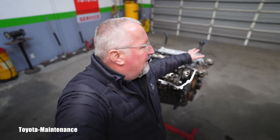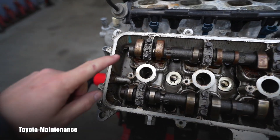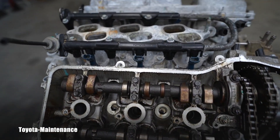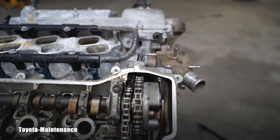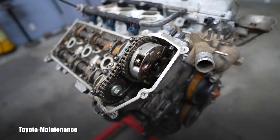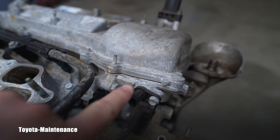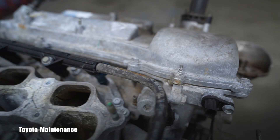We have no idea what's happening underneath the other side, which seems to be still factory closed. I will bet it was actually never resealed. This is what we saw on the passenger side — all that rust doesn't belong here. This engine was unfortunately exposed to the elements. It was from a 2008 Tundra single cab, the basic model. It failed apparently at 280,000 miles and was sitting out in the rain.